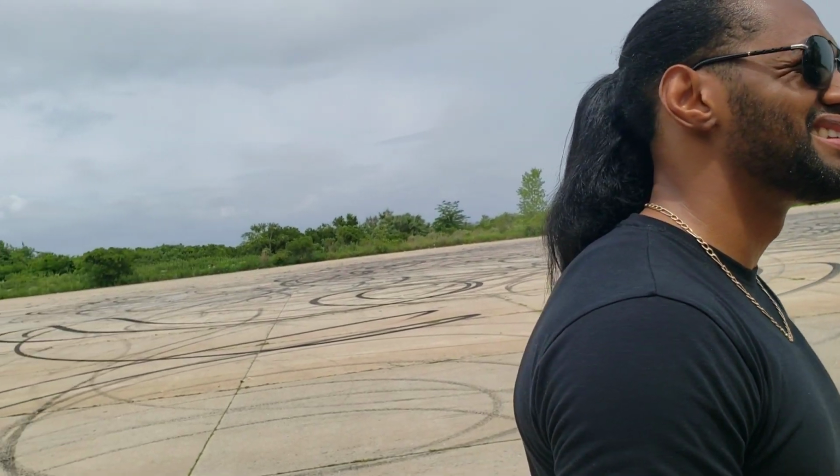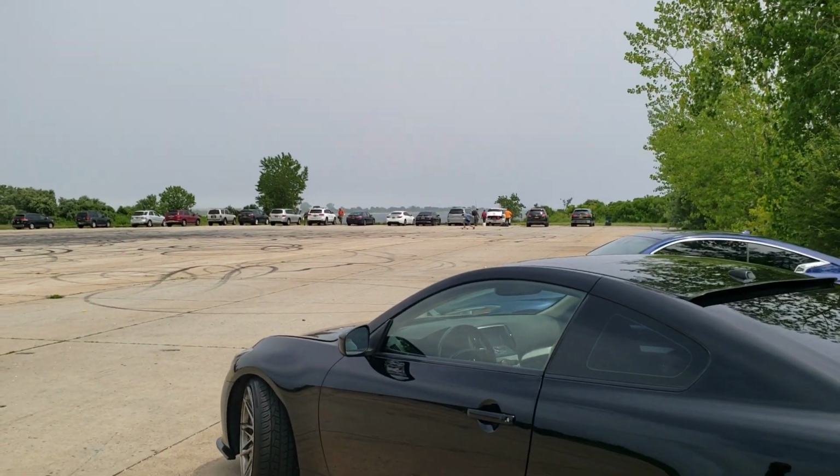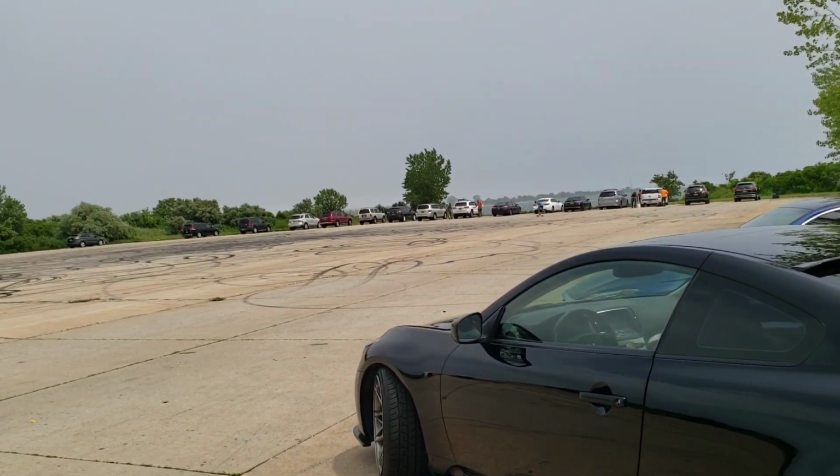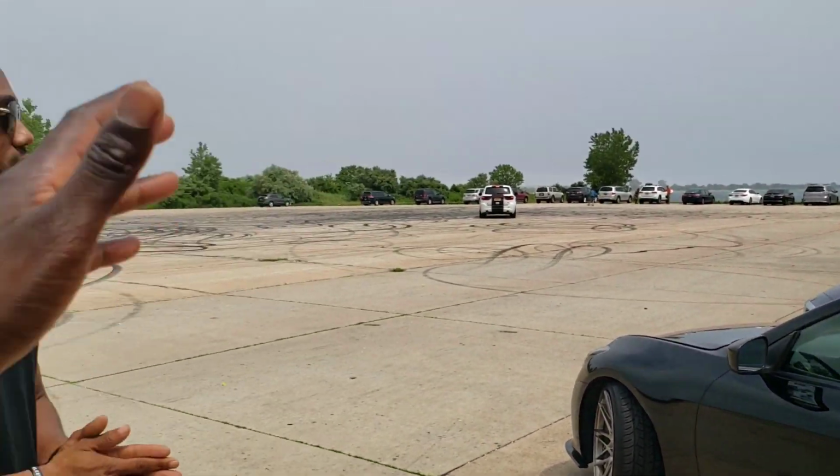And this is tuned on Up Rev, right? On Up Rev tune, 93 fuel. And you dyno to how much? I'm at 317 wheel horsepower, 272 torque. That's pretty common for the VQ community. You're going to get between 310 and 330 wheel, depending on if you have test pipes or if you go up with headers and E85.